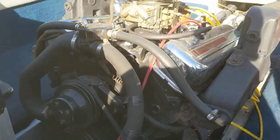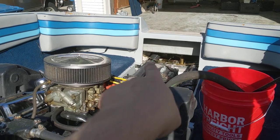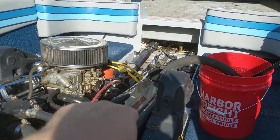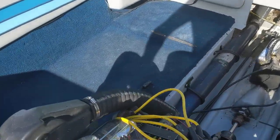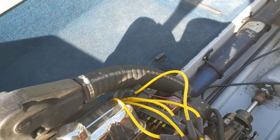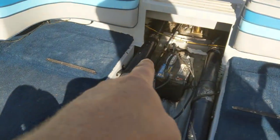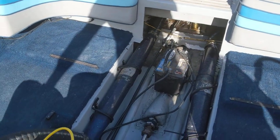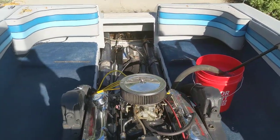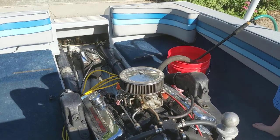If the thermostat is open, it's going to go all the way through the engine. If it's not open, it'll try to bypass and run through here and clog your manifolds. I learned this the hard way — my rear starboard muffler hose, there are these big huge hoses that come off the risers, and they were all bubbled and the back one was completely sealed off because they had gotten so hot running straight exhaust gases — which is like fire right through a rubber hose.